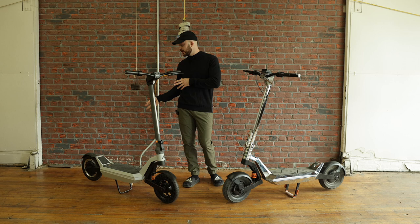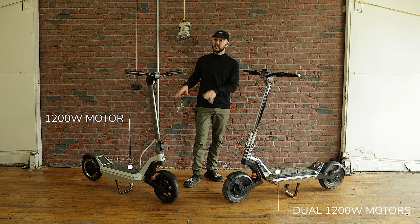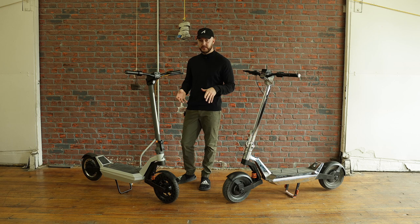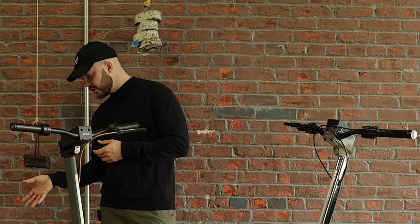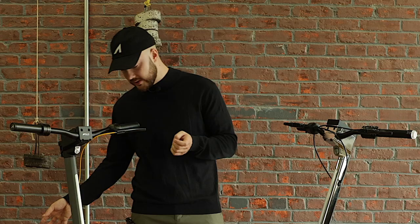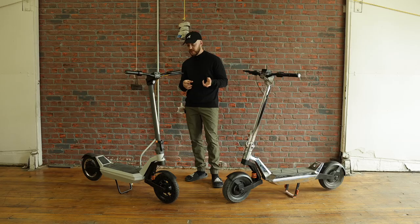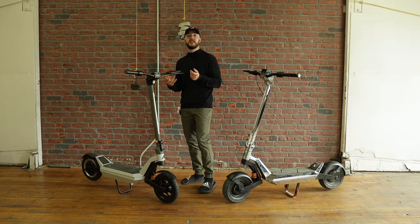Starting at the rear wheel: the V1 has a 1200-watt motor just like the V6, but it was a single motor and the tire was only two inches wide. You can see it's a lot narrower than on the V6, which changed the style completely — the V6 looked way beefier. The V1 also didn't have self-healing tires; it was a tube tire, while the front was a honeycomb airless tire. So it wasn't the most comfortable, and at this price point, self-healing tires should be included.